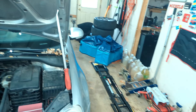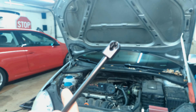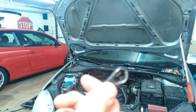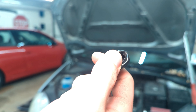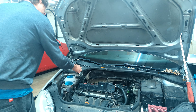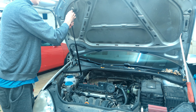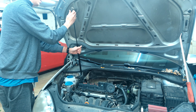Uh-oh! Okay, I imagine this will hold much better. On the new one, you can see the metal clasp is actually what holds it in. We don't have to remove this to get it in — we should be able to just push right through. The bottom one pushes right in, and for the top one, just twist the strut a little bit.